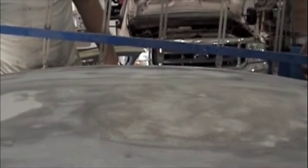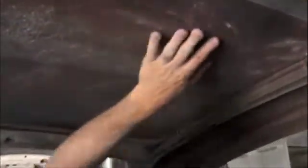1967. If you take the camera and go on the inside of the roof, underneath, you'll see that whatever repair was done there was not any type of cracking or anything. And you can feel the bow right here all the way through. That makes me believe that this was all the way back to factory, popping off the mold, which is common in a fiberglass car and stuff like that. You can get a pocket, a pull pocket of any kind, but that is all solid and good. So we're gonna make that look perfect again, the proper way.